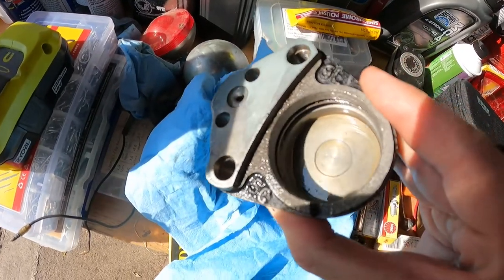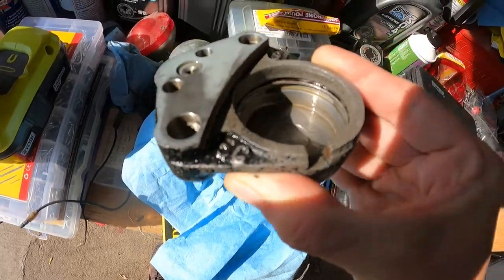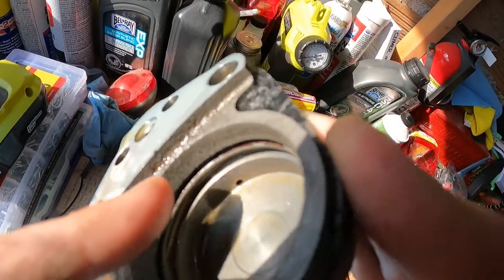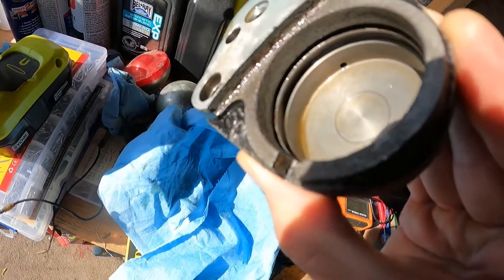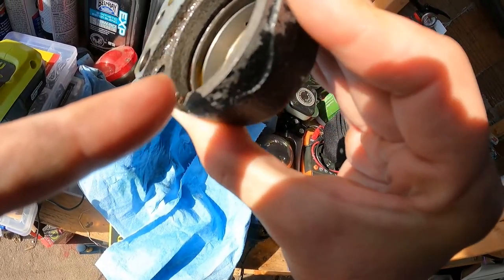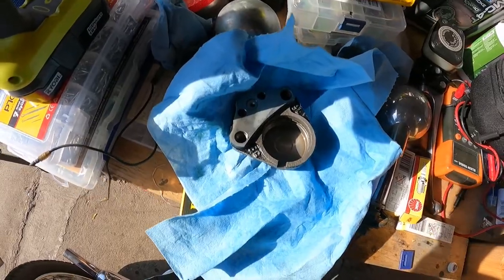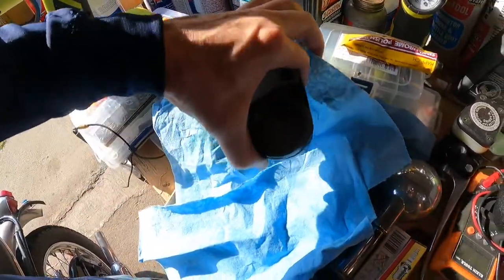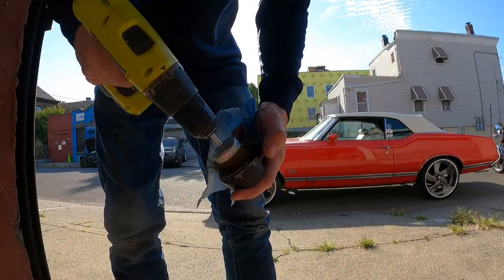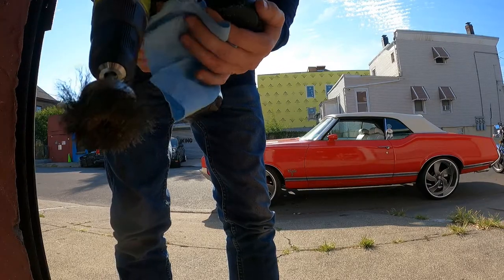We've got the caliper split, right piston out, and it's soaked in Evapo-Rust for 14 hours, but there's still some grime in there. And you know, we're gonna have to paint this surface, or you can't leave that raw steel. So we're gonna have to mask the shiny bits, that shiny area in there, and then paint everything else. So we're gonna have to take a brass brush to it so we don't do any damage, but at least we clean it up. So let's see. Do this outside. So let's grab this and the drill. But really I just take... Just like that.